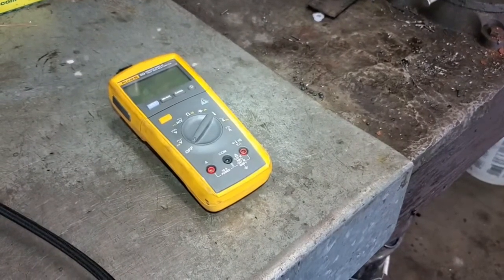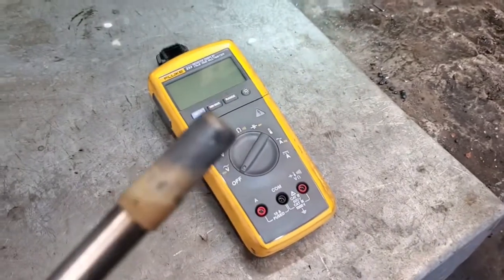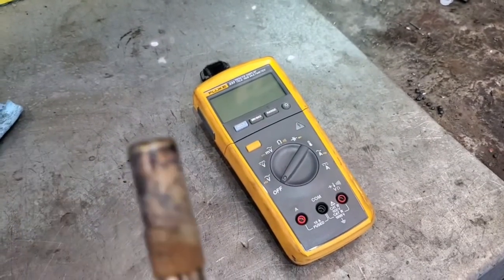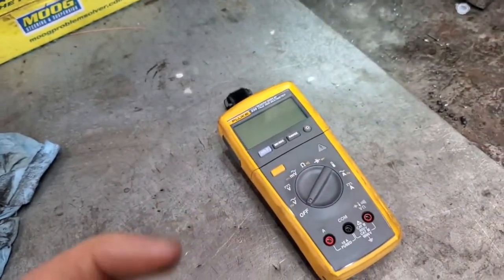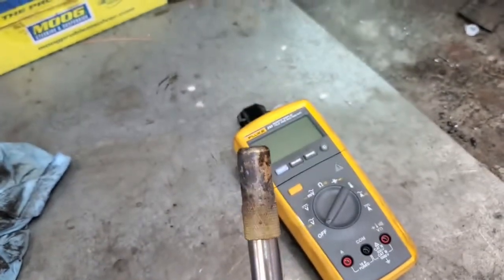The whole reason why you get a high voltage reading on this oxygen sensor is because when you're heating it with flame, you're actually putting the flame itself on the sensor, so all of the fuel has not completely been burned off yet. That's why it shows a rich condition, even though the stoichiometric ratio of propane is 15.67 to 1, which is higher than gas at 14.71. You're still going to show a high voltage because you're putting the flame with the fuel into the sensor and it has not completely burned all that fuel yet.